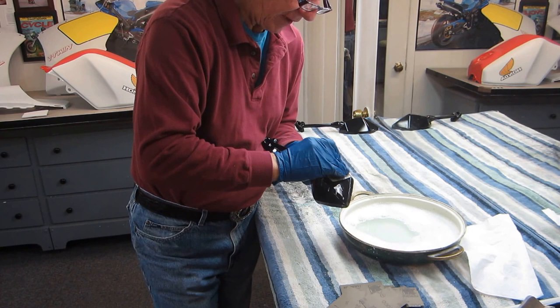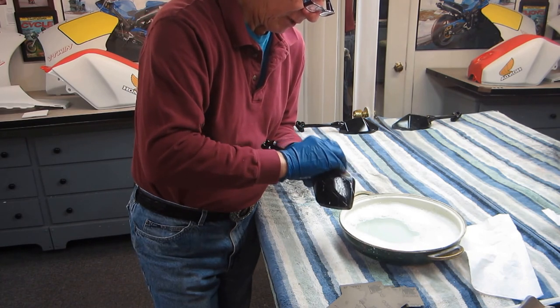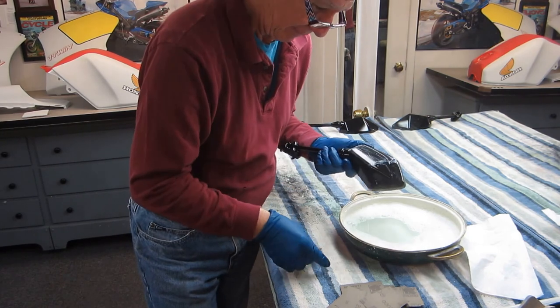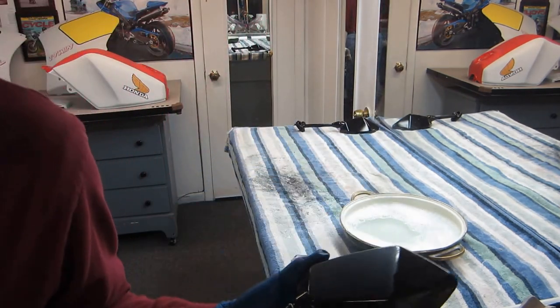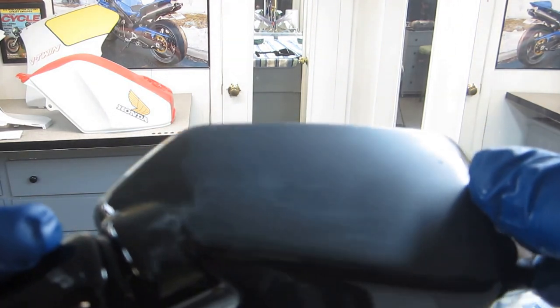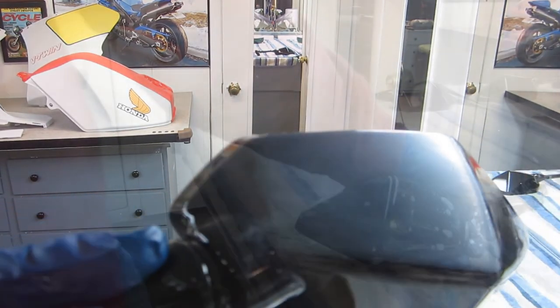These mirrors, as insignificant a part as this might be, every little bit on that bike helps. At the very beginning there were a lot of flat black parts, and one by one as I've turned them into shiny black parts I've liked the look of the bike. Now let me show this - the paint flattened right out, but you can see up here there are still a couple of little what I call moon craters. We want the whole thing to look flat before we even try to buff it. If it's got any of those little spots, we're just going to keep sanding - we want that to be perfectly flat before touching it with rubbing compound or buffing compound.